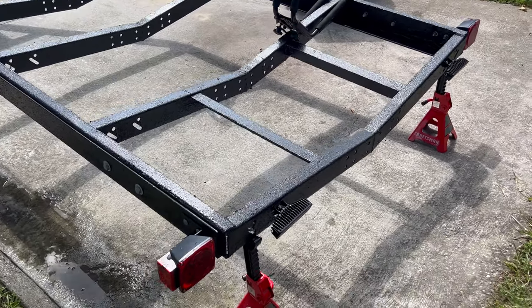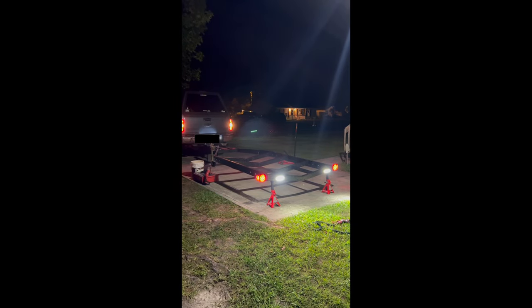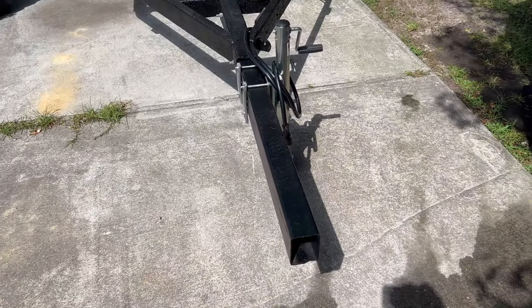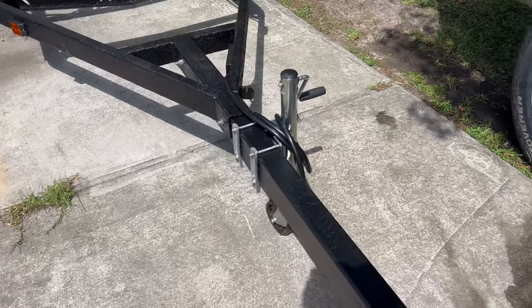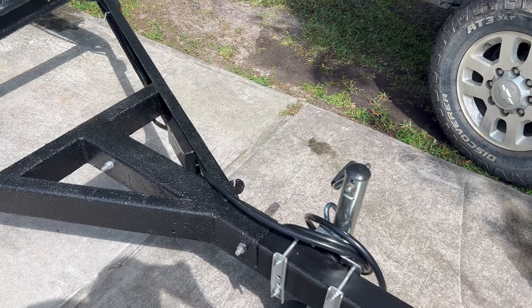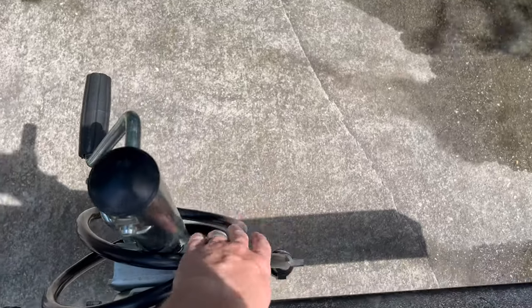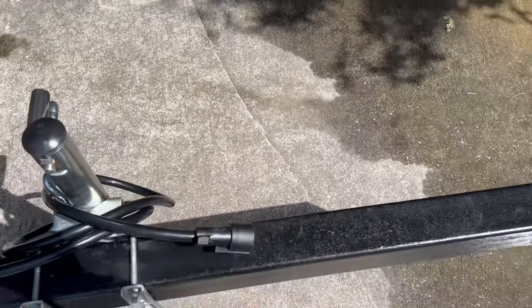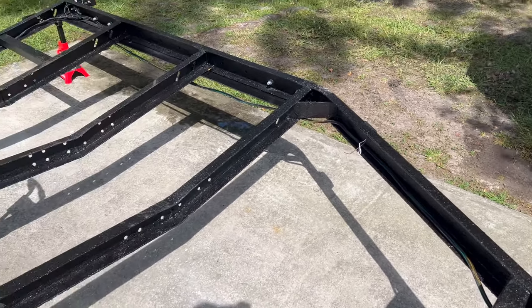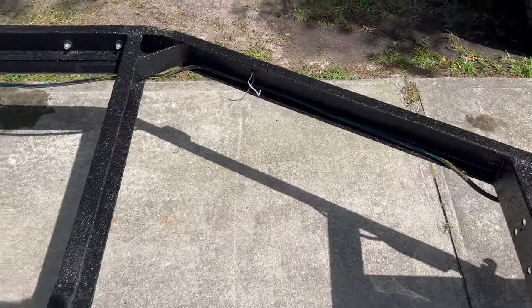It's been a couple days, working on it here and there in the evenings. The tongue got bed-lined and cut down. I'm waiting on the Dexter Drop-and-Go low-profile hitch to bolt on; put the old wheel back for now and haven't decided whether to keep it or go to a standard flat plate like campers use for more stability. I did the seven-pin connector instead of the four — I'll have to trim it down since it's eight feet long and I only need it to reach the truck. That gives us the ability to do reverse lights and in the future add a 12-volt battery system that can charge off the tow vehicle.